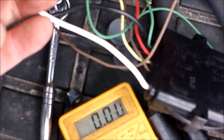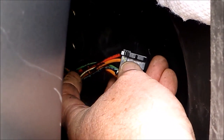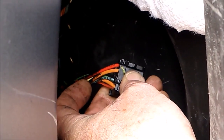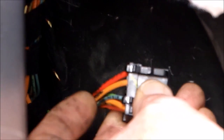The positive is that red wire we showed you under there — this is going to be the positive connector. I'm going to have to snip this off and use another connector and it's kind of tight to get in here. That top red wire is positive. If you're hooking up the negative, those two brown wires — the bottom one and the middle one — you'd disconnect and hook up to the negative on your trailer wiring adapter, the red to the positive. Then we'll grab the other three wires for the brake lights, turn signals, and taillights — four wires.